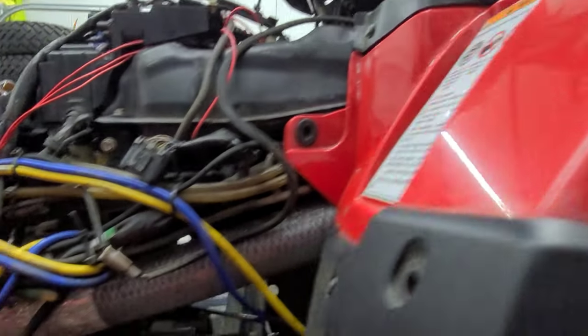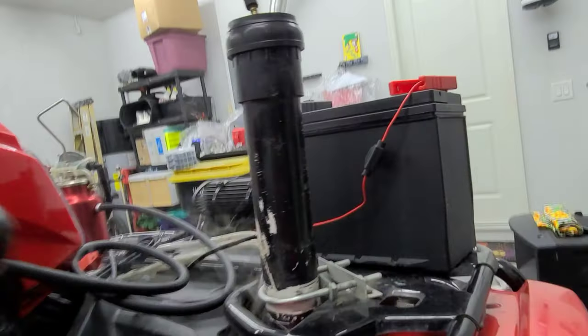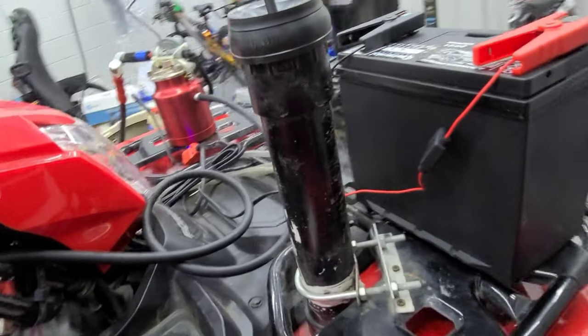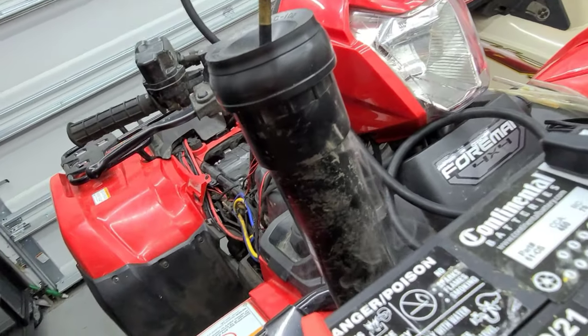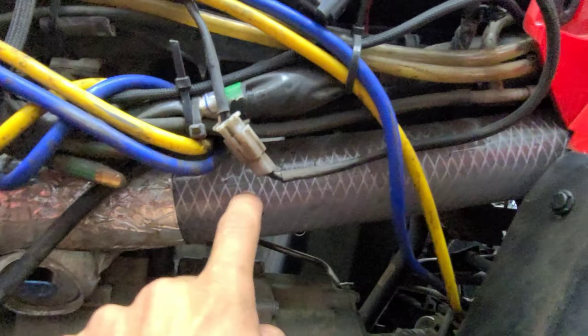You can see it actually in there. It's filling up the whole pipe. So far, it's completely sealed. And so you're simply just gonna follow it. As you can see, this thing is pumping out an enormous amount of smoke at this point. It's pouring out of here because there's so much, the whole line is filled up. It's clear on this bike, and you can see this whole line's filled up.